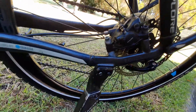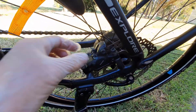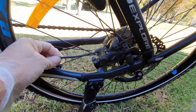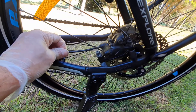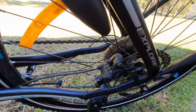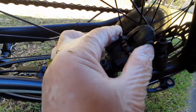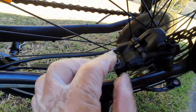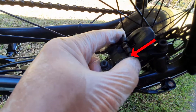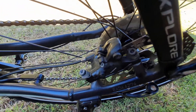I've got Shimano disc pads — I believe they're dual caliper. The disc sits between the two pads, and when you press the brake, on these hydraulic brakes the fluid squeezes the calipers together and slows you down. These pads have split pins just to keep the pads in place. Some have a bolt mechanism you undo, but these are split pins.